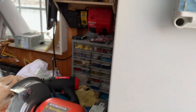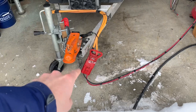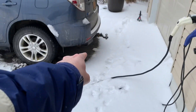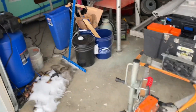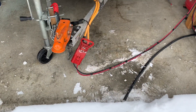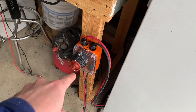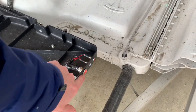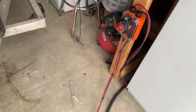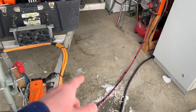And what I did for wiring up here — I'll start right here with the battery pack. So I have an Anderson SBX 350 connector, and that's the same connector that I use for the car to power the car. I have more connectors and I'm going to have one on that T-Rex as well. So then I have 6-gauge copper stranded wire going to a switch here. I have this switch which I can quickly turn on or off — this is the main power switch for the whole system, and then this is just the contactors inside the battery pack. So I have a lot of ways to quickly turn this off.